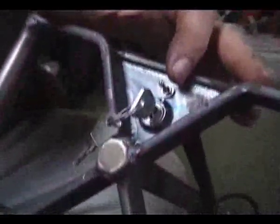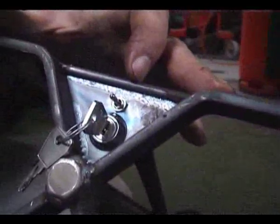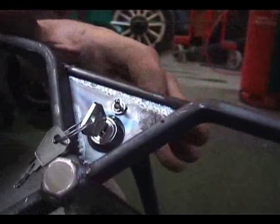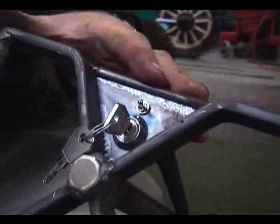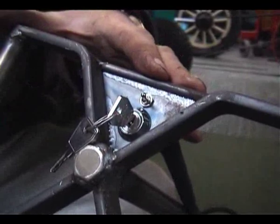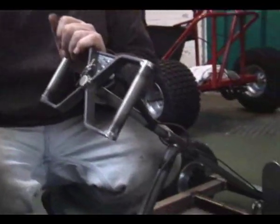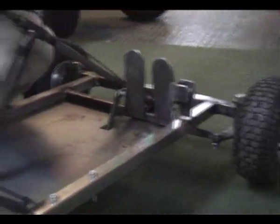On the very top we have a small switch: neutral is facing dead towards you, reverse is to the left hand side, and all the way to the right is the forward position. When you want to reverse, take your foot completely off the throttle — the system won't work otherwise. Then move the switch through neutral into reverse and press the throttle pedal again and the vehicle will go backwards. The same applies going into neutral and forward. The reason you must remove your foot completely is so the machine doesn't try to go forwards while going backwards, which would have disastrous consequences for the electrics.